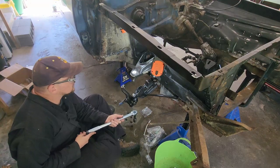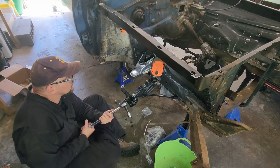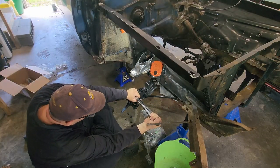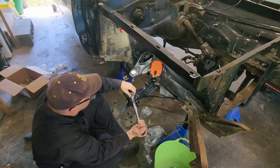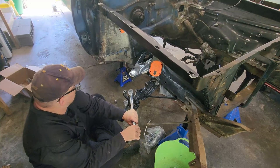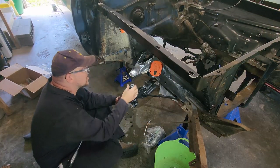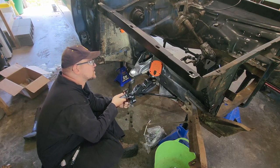The clip's in, so I can finish getting the front of this put together. Before we get much further, torquing this bottom one down - it needs to be 100 foot-pounds. We're gonna have to give it a smidge more so we can get the cotter pin in.